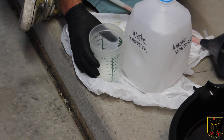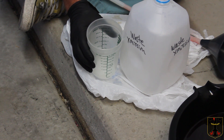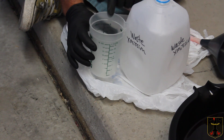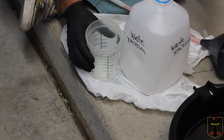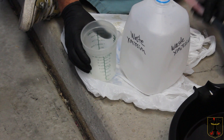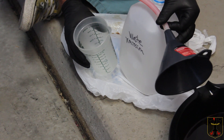I'm going to pour the drained fluid into this measuring cup, then into the waste container, and take a count. In this case it's two cups, so that's a half quart per measuring container. When I get it all transferred over I'll have an exact count of how much I need to put into the transmission using a transmission funnel, which we'll show you here in just a few minutes.